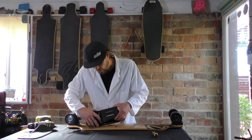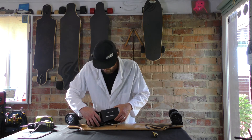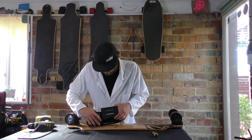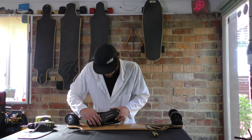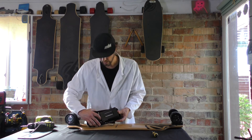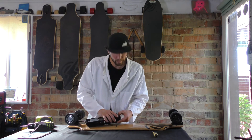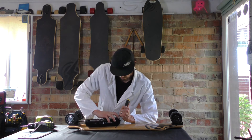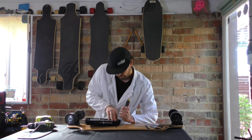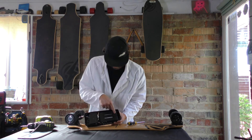Make sure that your motor wires fall into the little gap in the casing right there. You don't want them on top because they'll get squished when the whole thing gets put back together. So make sure motor wires are down where they should be in that little gap. Then you're ready to insert your battery under those two clips, and you're going to pull back on the clip that we used to disassemble. Once you do that, it's just going to drop straight back in — just make sure that those three clips are nice and solid.